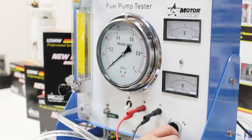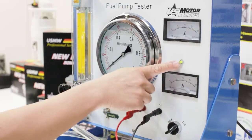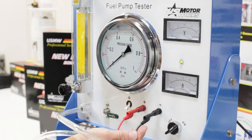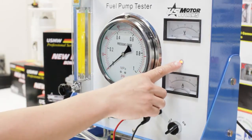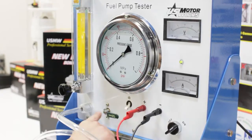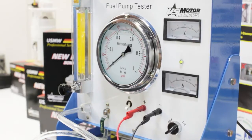This is the main power switch. When switched on, it allows the 110 AC power to go to the unit. The green LED will come on and the voltmeter will read 12 volts. The second switch is the output power switch that controls the power to the output terminals that attach to the fuel pump. When switched on, the LED will turn red, telling you that the output power is live. Next to that, we have the main test valve. In the horizontal position, you will read maximum flow rate; in the vertical position, you will read maximum pressure.